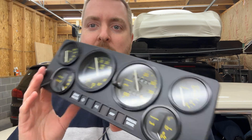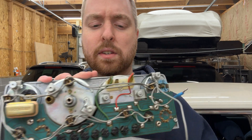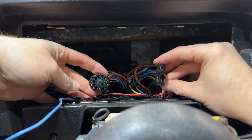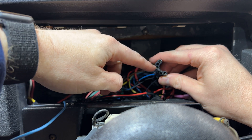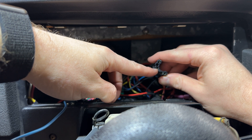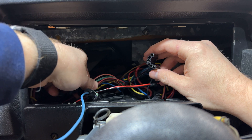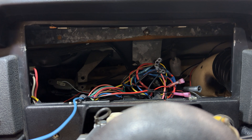All right, so I'm out in the garage, got the gauge cluster. We've got to hook up the lights separate, the volt gauge and the oil pressure gauge — it has all its own individual wires. The tach has its own wire. Then there's our round plug and our half circle plug that we pinned — these are the two main plugs. It was this hole that you either have to drill out or get the plug from the 240 cluster, because in the 140 that pin position is plugged. I used the 240 one so I can lock it in there. This is the parking brake wire — this is the one that was not seated all the way. I'm hoping I'll hook all this back up, plug all these little wires, start it up, and see if everything's working.